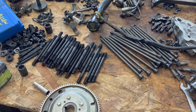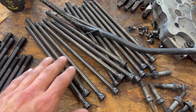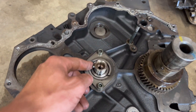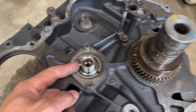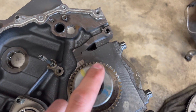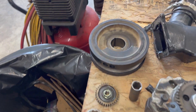I tore the motor apart expecting possibly a sheared cam pin. I checked all the push rods — none looked bent. On Duramax engines, cam pins can shear off, but this one is still intact. The crank pins are intact as well, except for the balancer. However, that wasn't the issue because they had a DIY keyway in the crank, visible in the harmonic balancer.